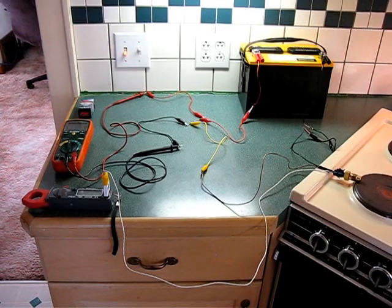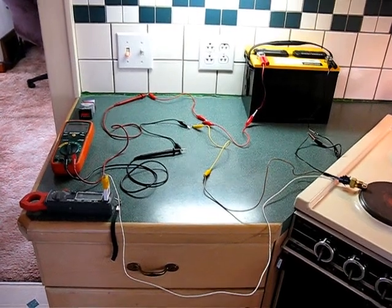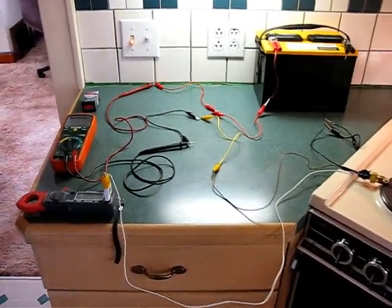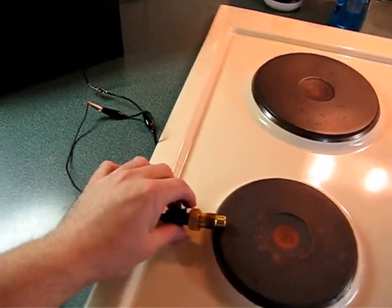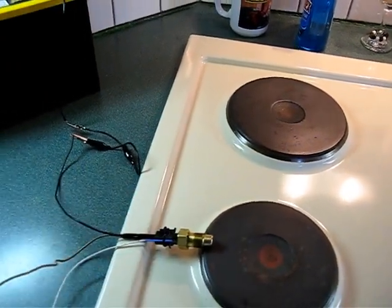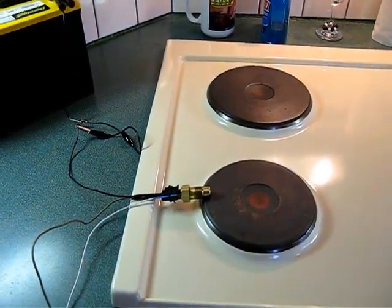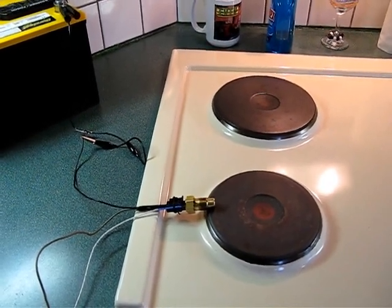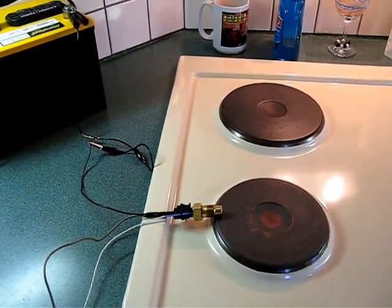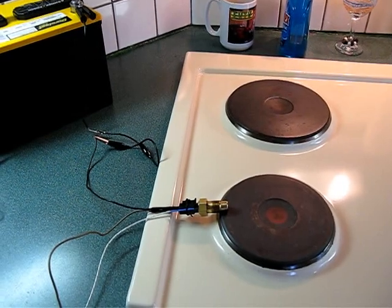In order to do some serious testing with the car and push it to its limits, I'm going to need to know what the temperature of that motor is, or at least have a pretty good approximation, so I can pull over and give it a break if it needs it. What I'm working on here is trying to make the original engine coolant sensor work with the Soliton 1 and the electric car. Specifically, there's this little sensor that screws into the front of the gasoline engine where the coolant or antifreeze goes through next to the thermostat. In the original car, it's connected to the engine computer and affects things like timing, fuel flow, and all that kind of stuff based on how cold or hot the engine gets.